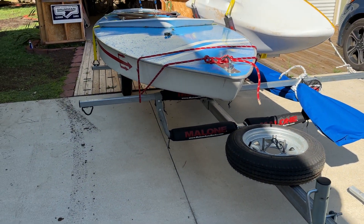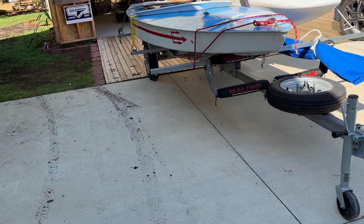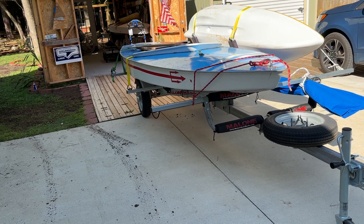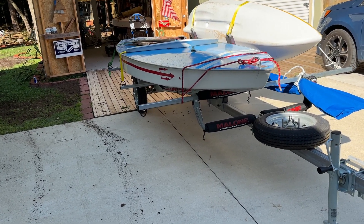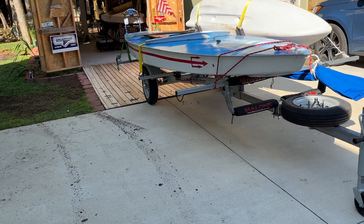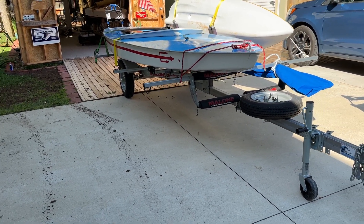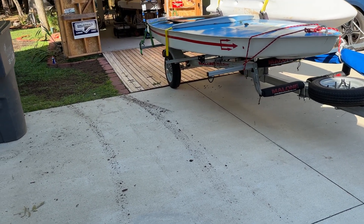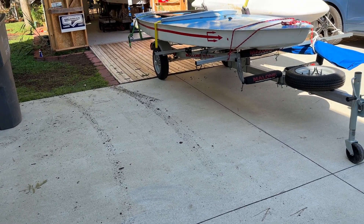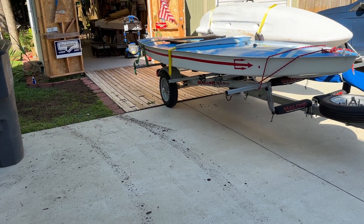Let's round up to 200 pounds — we're not running it even half of what the trailer's rated for. This one's got pretty good single leaf springs, set up pretty nice, it's got a good ride whether it's empty or loaded. Some trailers you might find they're going to bounce all over the place if you're hauling them empty or with a light load — you can mess around with that a little bit. If you've got triple leaf or double leaf springs you can talk to your trailer guy, maybe get a different set of springs or take a leaf out. We don't mind running the tire pressure down a little bit because we've got the 12-inch tires.